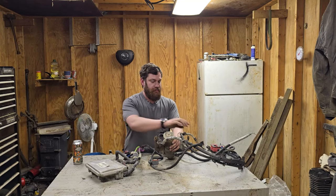You can get rid of your AC plug. Your other O2 sensor - that's the downstream side, you only need the upstream. That's pretty much it. The biggest thing is: if you get power to your pink and orange wires, get power to your fuel pump, and delete the VATS - the vehicle anti-theft system - off of this, it'll fire up. No questions about it, it just will.